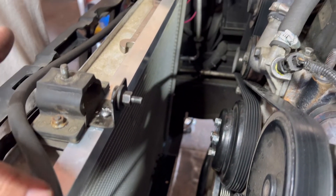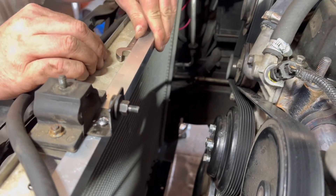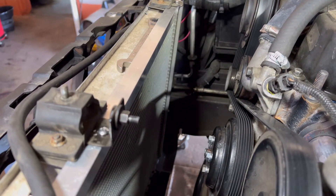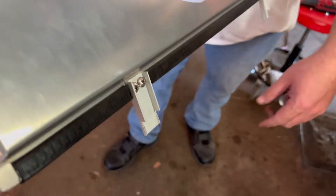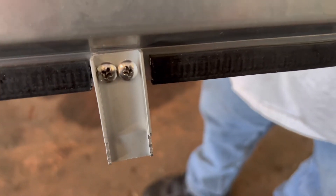Now that the aluminum is mounted on the top edge with self-tapping screws, everything's rock solid and won't move at all. Here's the fan shroud — these tabs are going to go into the factory location down at the bottom of the radiator. The factory had little plastic pieces in there to keep the plastic shroud from flopping around, so I'll need to pull those pieces out.